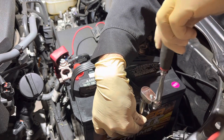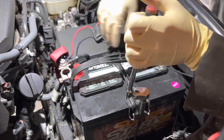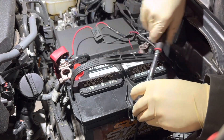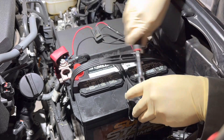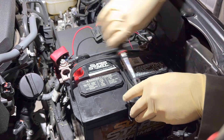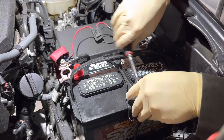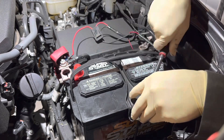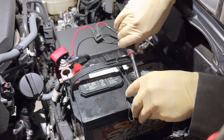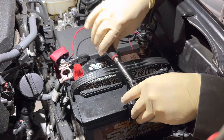Now it's nice to have a battery saver when doing batteries. What that is, is it applies a small amount of voltage to all of the vehicle's computer systems. There are multiple modules throughout these cars — transmission control, the radio, the clock, cruise control, ABS, all kinds of stuff. When you disconnect a battery, you're completely draining all those systems, so sometimes the car is going to have to spend a little time relearning some procedures to get back to normal, which can throw a wrench in the mix.